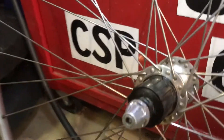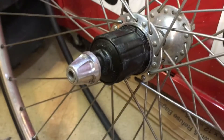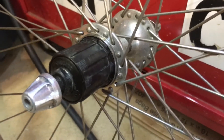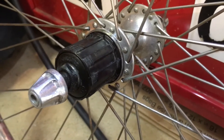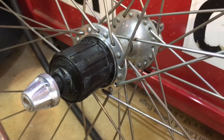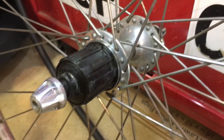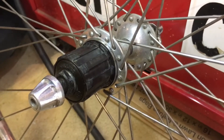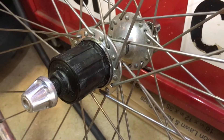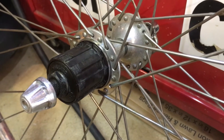However, if you happen to work on a bike from the early 1980s, you might come across one of these. This is a Shimano uniglide hub that predates hyperglide by a couple of years. Shimano only sold these for a few years in the early 80s, so they're not particularly common nowadays. And for a couple of reasons, they're incompatible with hyperglide hubs — though they look very similar.